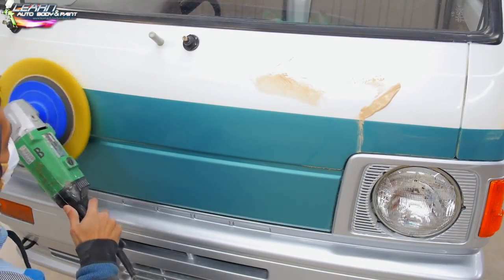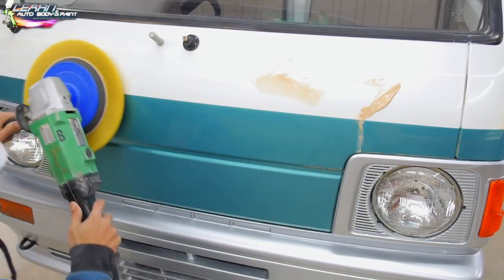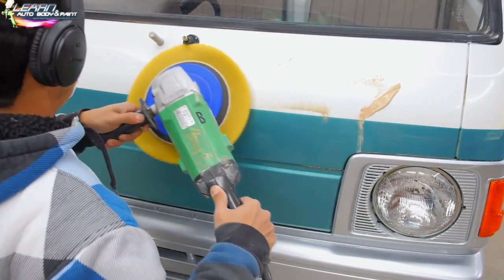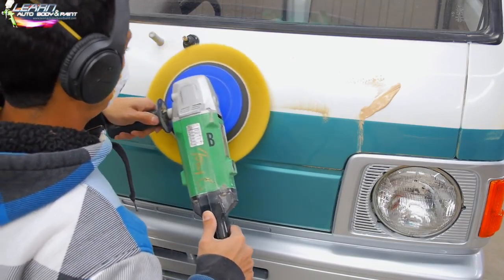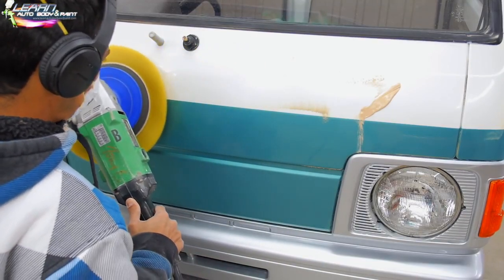So this is the first step. You want to get it glossy. If it doesn't look glossy after you do this step, you did something wrong. You basically didn't buff enough, right? And you could buff over it with 2,000 grit, which is the recommended. If you want to go extra, you can go 2500. But you don't have to go to 2500. 2,000 grit is more than enough.